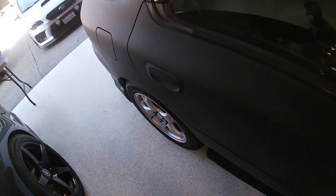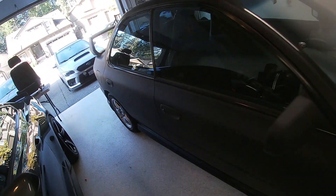Last episode we fixed up the rear brakes on the Fuji here. They're working all right, but they still could use a power bleed. I did a full fluid swap with Motul RBF600 but I still need to fire a bunch more through the system — I think there's some air in there. I've either got to power bleed them, gravity bleed them, do something. There's not a great amount of pedal feel, so there's still some messing around to do there. But today we're focusing on the interior.